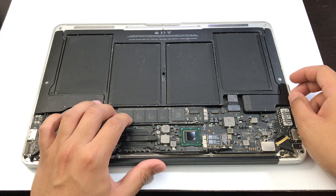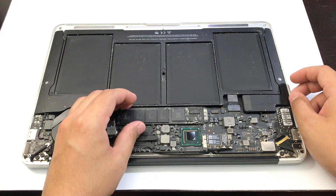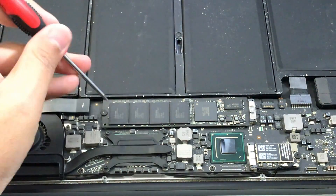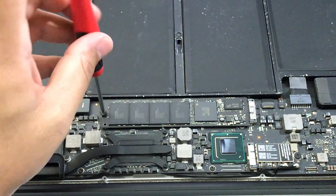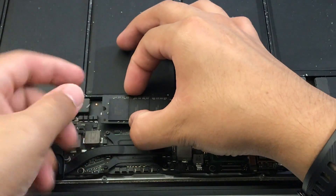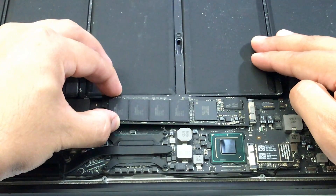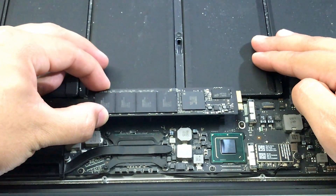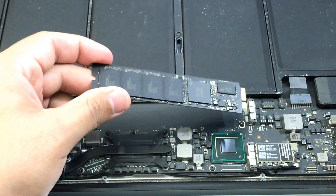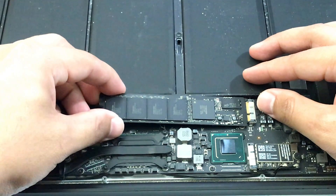This is your MacBook's SSD. You're going to need to disconnect it and connect it right back again — for the screw you will need a T5 screwdriver. Slightly lift the SSD up, then start pulling it from the slot. Just wiggle it gently and eventually it will come off. Have it disconnected for around 30 seconds, then insert it back very carefully. Try not to push too hard and it will slide right in.